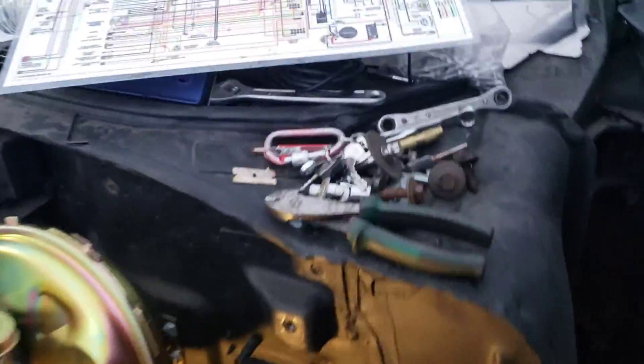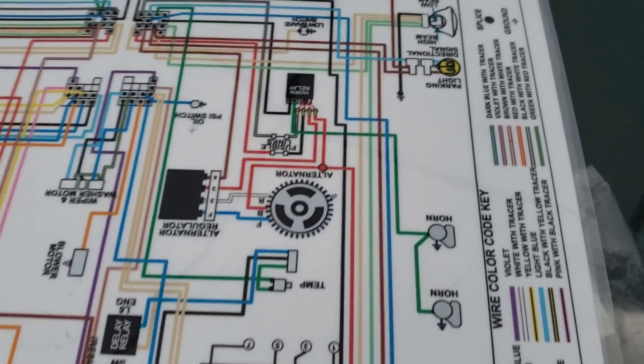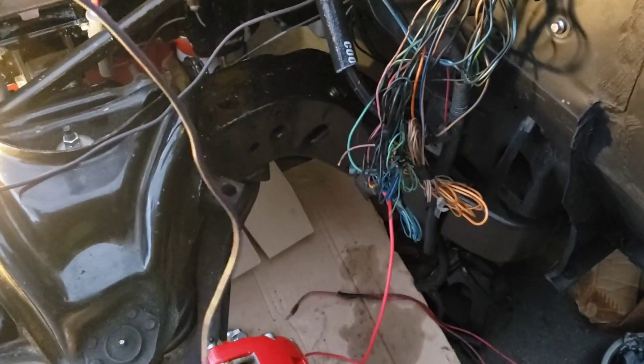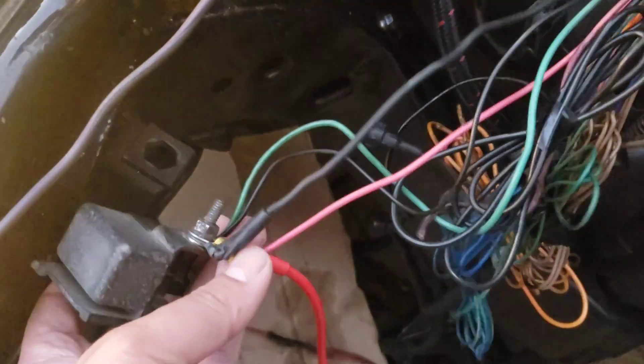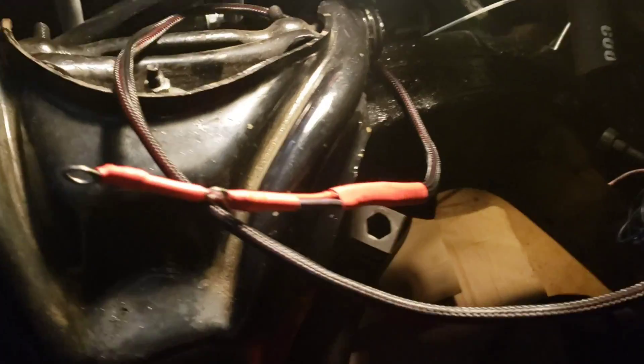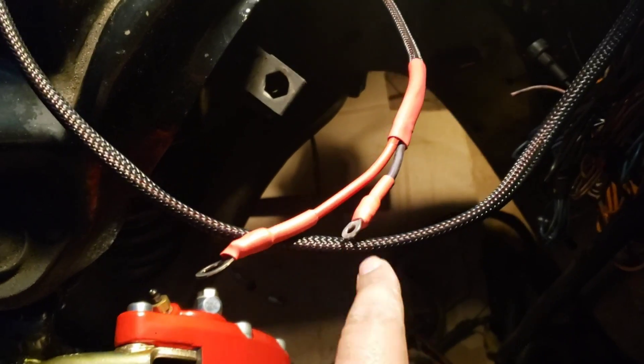The factory wire is so good, so I'm going to trim it and put a new end on it. I'll redo the horn relay and redo these two because they're old and about to fall off. That's the starter wiring — I just wrapped it up to give it some abrasion resistance. It's the purple wire that goes to the S terminal.